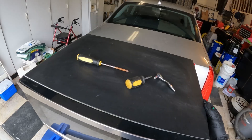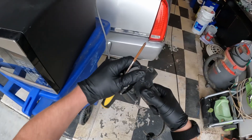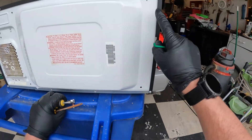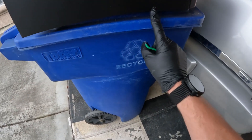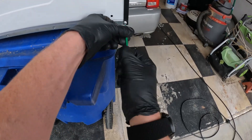You're also going to need a magnetron — I'm going to link the parts and tools in the video description down below. First thing we're going to do is unplug it. We're going to come around to the back side of the microwave where there are a couple of security bits that hold the housing on, and on the side there are a couple of Phillips head screws to remove.